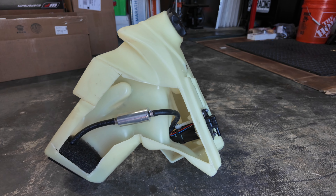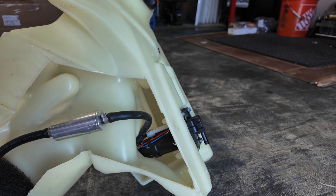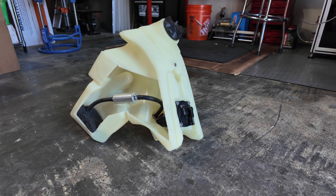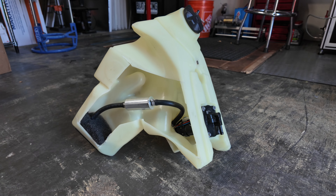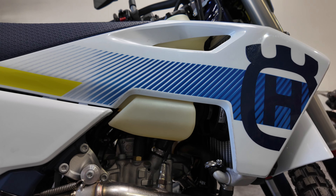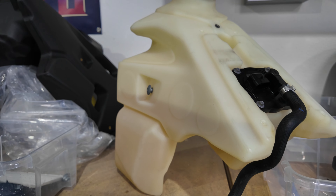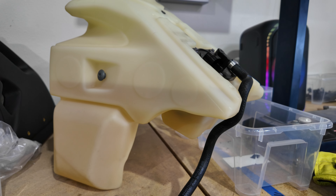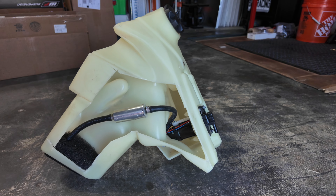It's created more problems for the KTM because there's a lot of fuel at the bottom that you're not picking up. They say if you ride off-road and bounce around, the fuel splashes up and it's fine — but lots of people buying brand new bikes are getting only 35 miles out of the tank because it's not picking up the fuel. The fuel pump itself is way better and you won't have as many going out as previous generations, but it creates another opportunity for companies to solve the fuel pickup issue. Tacomoto has a fuel pickup solution coming to market very soon.